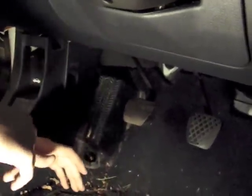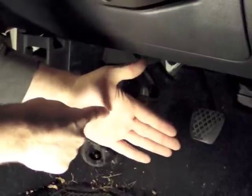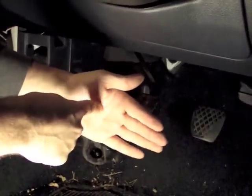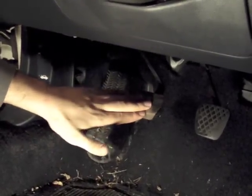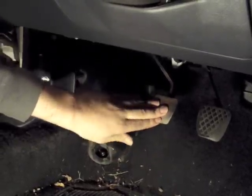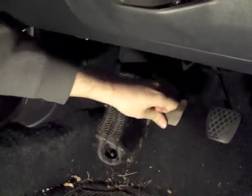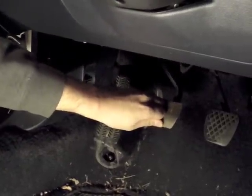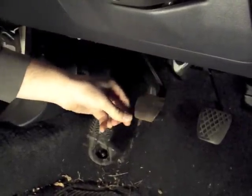So we're inside my car right now. I'm just going to explain a little bit of the problem with what's going on here so you guys can see it for yourselves. Basically, if we look down here on the clutch pedal — all clutches have what's known as end play. End play is basically this little bit of movement right here where you just rest your foot. That is actually the rod itself in the gap between it touching the cylinder and the master cylinder. If I push, the clutch is going almost halfway down, and it's right around here where I'm feeling the pressure. Most clutches shouldn't be too easy to push with your hand or your arm, but this clutch is going quite a bit farther down than normal when I feel it disengage.